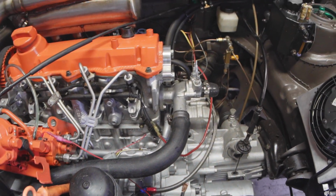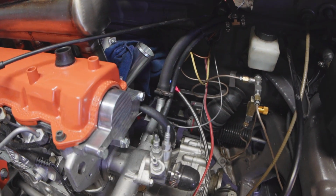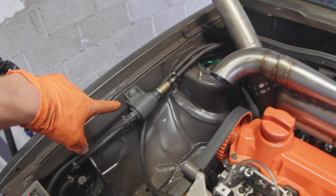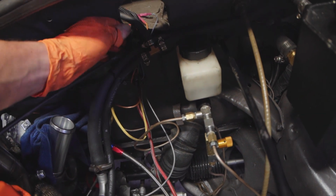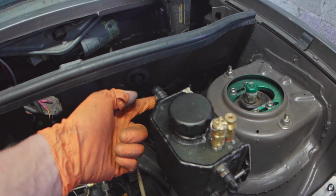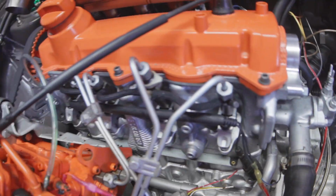Alrighty, so this is mostly finished product here. We have our steam hose, have our regular feed, and then the radiator steam hose goes up and around, up through here, and tees in. So we basically have the 2 air hoses that feed into the top as the return, and then this big bottom one is our feed down to the water pump.